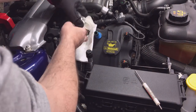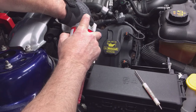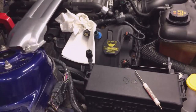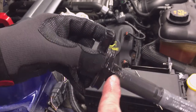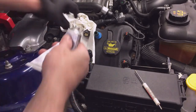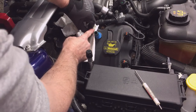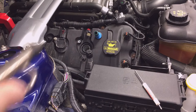I'm going to clean up the connector and the coil connector with electrical contact cleaner. Mine is really pretty clean already, but if yours is dirty spend a little extra time and clean it well. Then apply a little dielectric grease to the coil — both here in the boot and on the upper seal — to keep it soft and seal out moisture. Apply it to the electrical connector face as well; that'll help keep moisture out and make it much easier to disconnect next time.